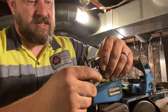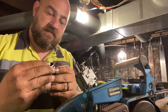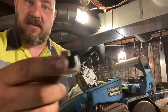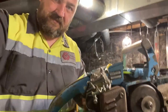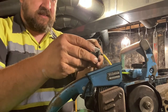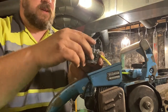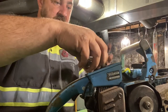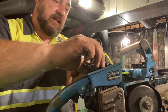Here's our reed cage. Here's the reed — I'm not a fan of this design. Let's get the new one installed. The reed has been the big thing for me because I've been talking about doing a ported saw — I can port it all I want, but if I don't have a good set of reeds it's pointless. I needed to figure out a source for good reeds, and that's why this whole test is happening. This test is leading us up to the ported saw.